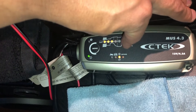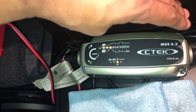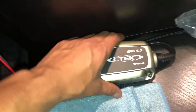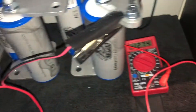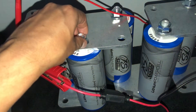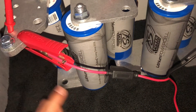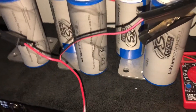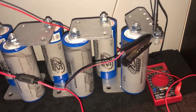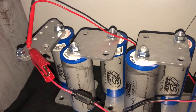The AGM snowflake there indicates it charges up to 14.7V, which is ideally where it's supposed to be. This thing's been working for the last 20 minutes and it's getting pretty hot. I've bolted it down, need to put a little silicone on here so it doesn't wiggle off. I'm going to measure it, find a box and cut it up and put it in there so I can drop it into the car.